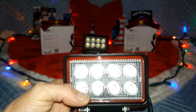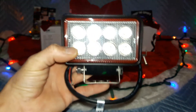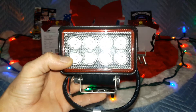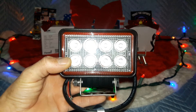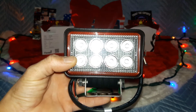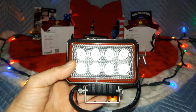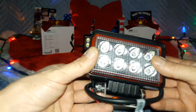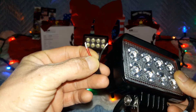These lights operate solely on a 12-volt DC input. With that 12-volt input you're going to get a 20-watt output. It's going to be a crisp, cool light. The current draw on that 20-watt output is rated at 1.75 amps, which in turn converts to an estimated 1,400 lumens. Very simple positive-negative tie-in to your vehicle's 12-volt electrical system.